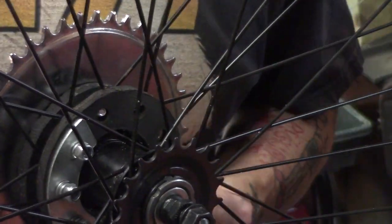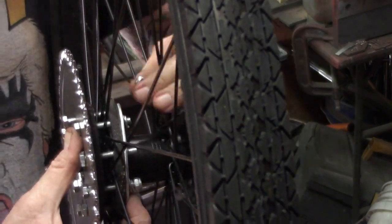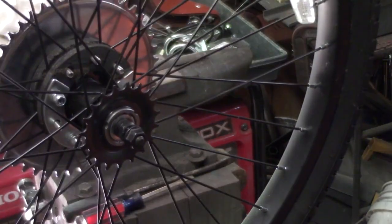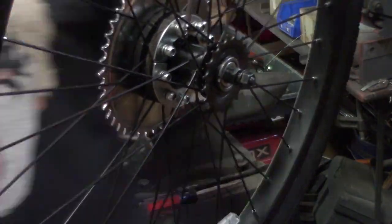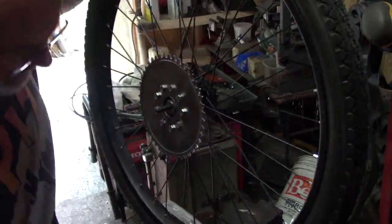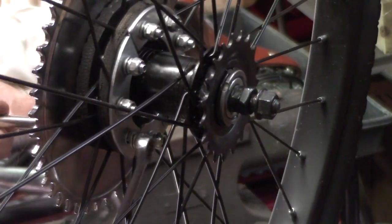You're going to need some wiggle room to go all the way around the sprocket and get both plates on and all nine nylock nuts on. Just do it a little bit at a time, turning the wheel in your vice. Once you've got all the nuts on and started, just go all the way around - I use my ratchet and give it about eight quick turns which gets about three threads through the nut. Back it up with your 10mm wrench and use your 10mm socket on a quarter-inch ratchet.